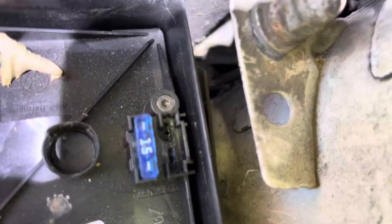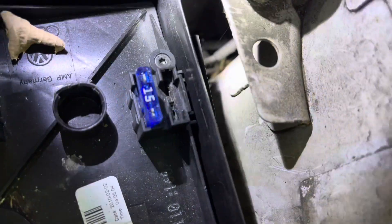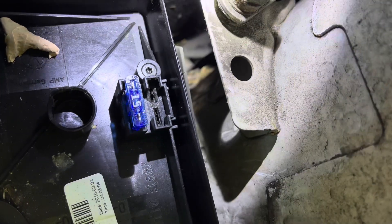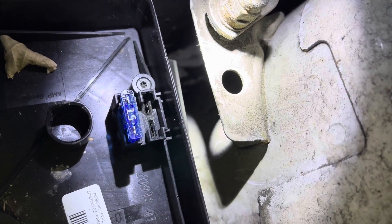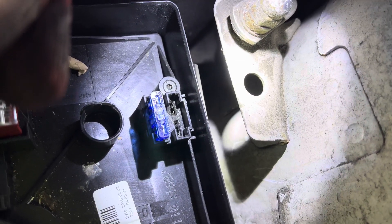If I go to its holder - go back around here - go to its holder which is Fuse 16. Right down inside Fuse 16, the top bit - it's hard to see again because of these iPhone cameras - but get some light on it: it's all melted. That is Fuse 16, and that's the feed to that side. So if you get open circuit Terminal 30 on a VW, check the fuses and make sure there are no melted blades.